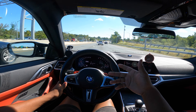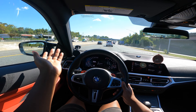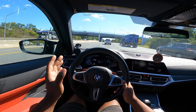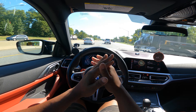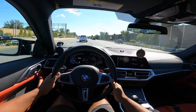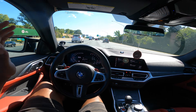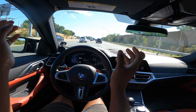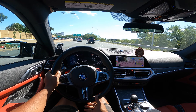Cars with DCTs — like the M4, or Porsche's PDK — you can sit on that thing because it's dual clutch and doesn't work like an automatic. It just snaps the clutch into play when it's go time, similar to a manual where you have the clutch in and you can hold it as long as you want, then let go and you're off. In the end of the day, I'm kind of happy I don't have the all-wheel drive one, because I probably would have broken some stuff turning up the power.